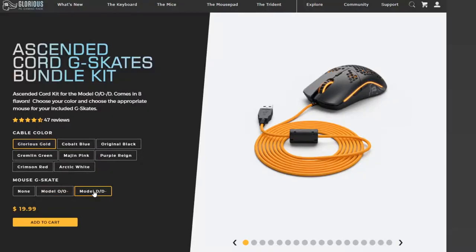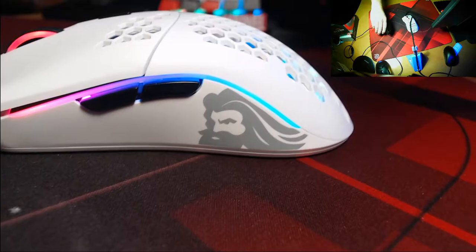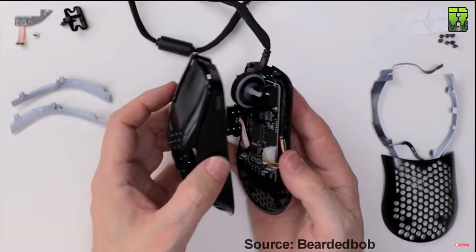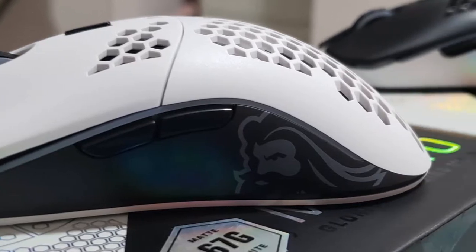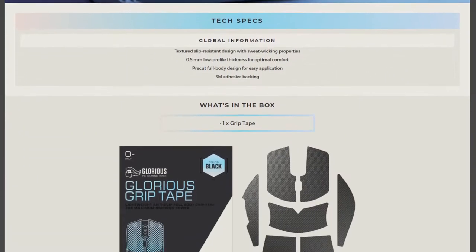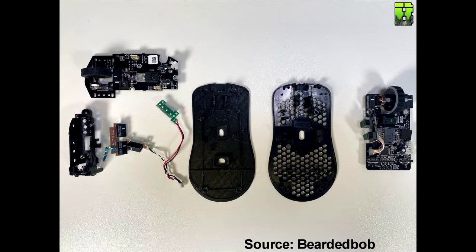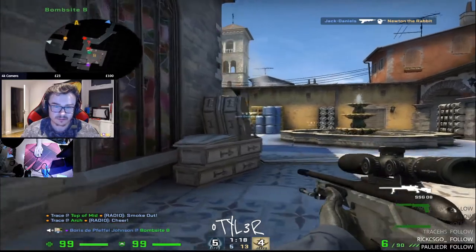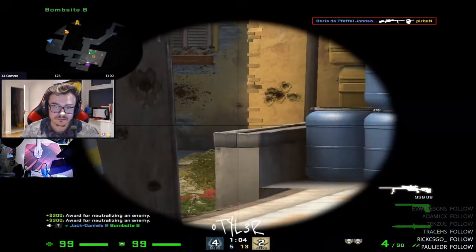The Glorious Model O has a huge amount of modding potential. Glorious have recently started shipping custom-coloured power cords which are extremely easy to install and require zero heat shrinking. You can remove the branding very easily on the white copies by sanding down the sides for a clean aesthetic. The RGB strips can also be removed easily, saving yourself around 8-10 grams. You can shell swap the Model O to get a black/white theme, and Glorious have also released grip tapes for the Model O. If you want to go wireless, grab yourself a G305 PCB and install it. Literally the sky is your limit with this mouse.